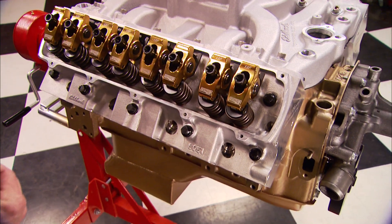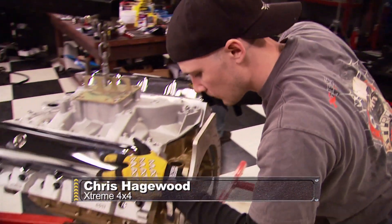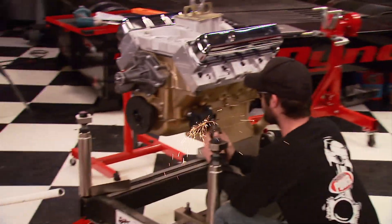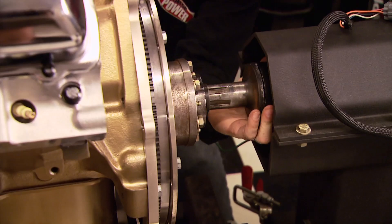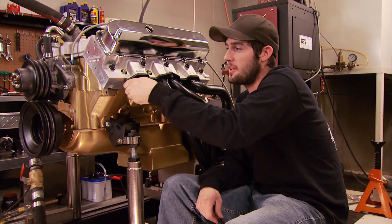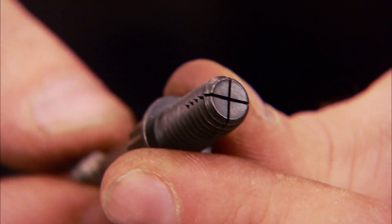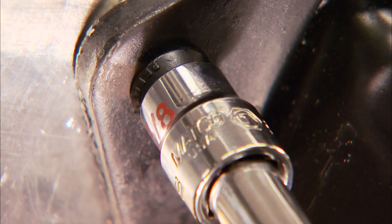These pretty rocker arms match our block so much I almost hate to cover them up. We're bolting up a set of Hedman long tubes with inch and three-quarter primaries that dump into a three-inch collector — they fit the old 400, 425, and 455. The fasteners are friction-lock fasteners from Percy's that cut two grooves in the end of the threaded portion of the bolt. An Allen set screw with a leg expands the end of the bolt once it's tight so you won't have a leaky header. Since it's a three-eighths bolt, torque it to 28 foot-pounds, then tighten the set screw with an eighth-inch Allen.